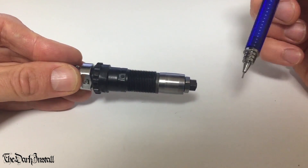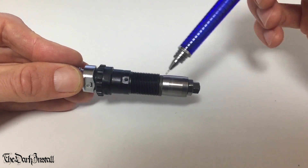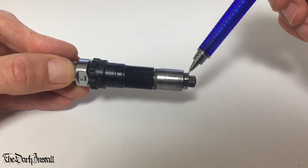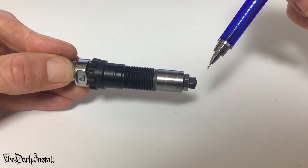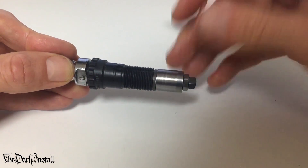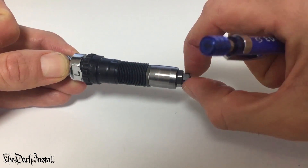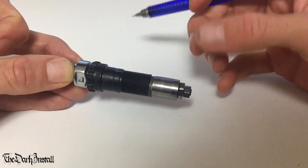This bearing system is far better than using cartridge bearings like a lot of other pedal manufacturers do. If you use cartridge bearings, they'll just put one here and one here, and that doesn't allow for any preload adjustment. Cartridge bearings are not the best idea for pedals. This angular contact bearing system with a locking mechanism and a preload adjuster is really, really good and extremely strong. Anybody who has Shimano pedals knows they just keep going for years and years. You never have to touch them, you never get play in them. They're absolutely perfect. And if they do develop play for some miraculous reason, just take them apart, clean it out, adjust the preload, screw this back on and you're good to go for another 10 to 20 years. This is incredibly good engineering.